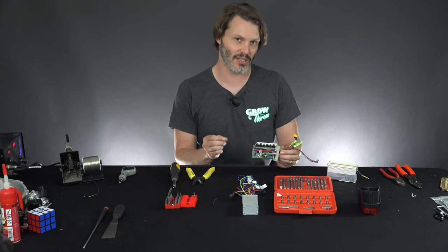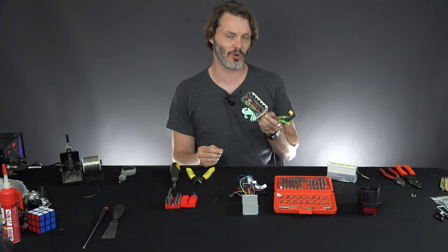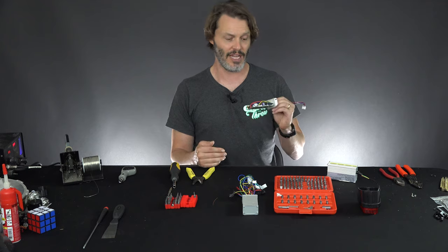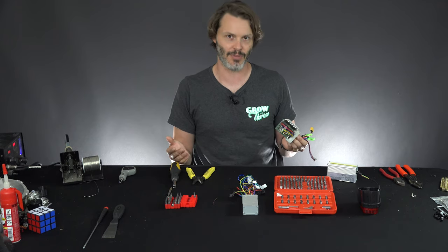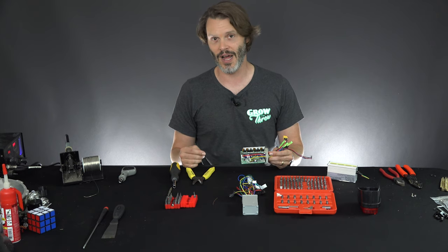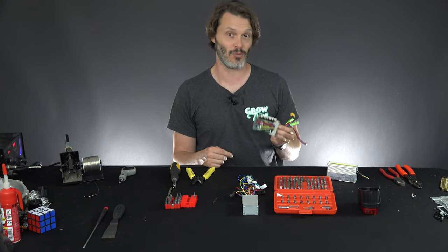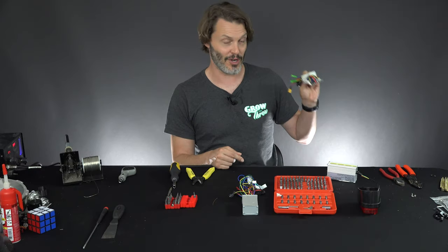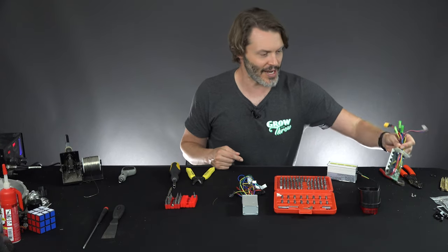I learned on this bike — another DYU bike — that even with the shunt mod we got a little bit more acceleration but no more top speed, and we really didn't get any more perceivable power other than barely a little bit off the line. There seems to be something in this controller that keeps it slow at first, and then once it gets past about four miles an hour it would have a little bit more torque until maybe six miles an hour, at which point the winding of the motor was too high and the voltage too low to get any more power. So in the end we didn't really get much from it, but I learned that I need to put about 72 volts on that particular bike to make it peppy.